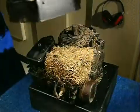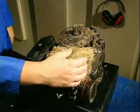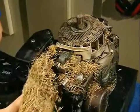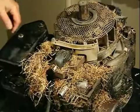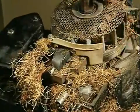Engine speed will increase if the blower housing air intake is restricted. Any restriction to the airflow into the blower housing, such as a plugged rotating screen, reduces air pressure against the vane. Engine speed will consequently rise as the governor spring has the advantage.